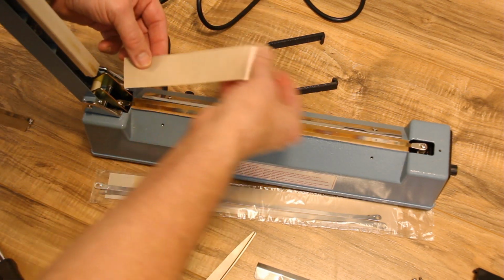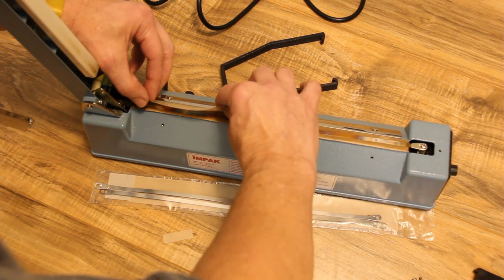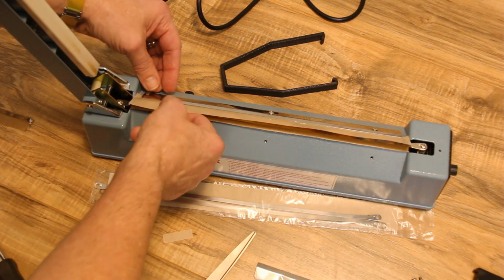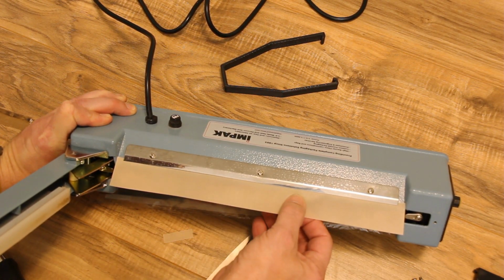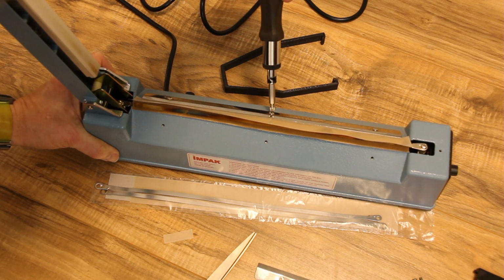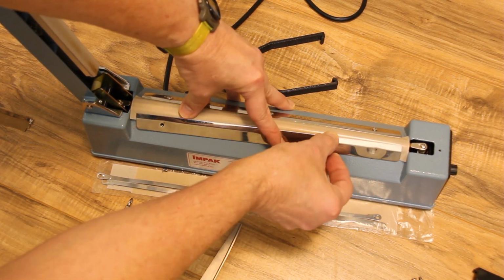The new Teflon strip is just a little bit long, so I cut it to length. Tuck one side of the tape under the metal hold-down strip that was left on. With the tape flat and smooth, tighten the 3 screws on the hold-down strip. With the first side secure, pull the tape across the top and into place on the other side.